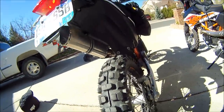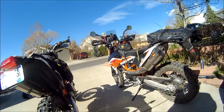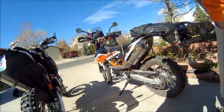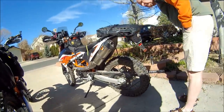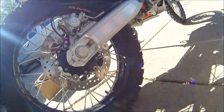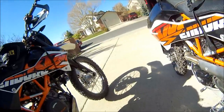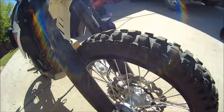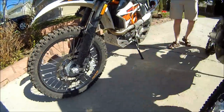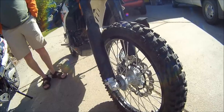What tire pressure do you have? I haven't even checked this thing. I think you'll lower these down to maybe 18 PSI for trail riding. I wouldn't go too low because we don't have security bolts — no, we don't. That makes it easier to change tires. I wouldn't drop down to like 10 pounds or something — you'd probably spin the tire, especially on the back with this motor.